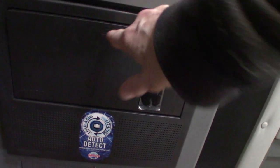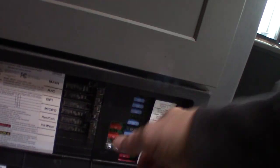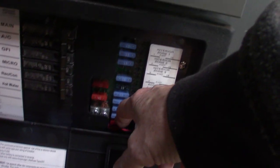This is your power converter — it converts AC to DC power. When you're plugged into shore power, you've got regular circuit breakers like you'd see at home: 110 AC, and they're labeled. The power is converted to 12-volt DC on this side — you've got 12-volt fuses and they're labeled. If they glow, you'll see them glow through this tinted plastic. Also, this is a battery tender, so it'll sense how much energy your battery up front needs and always keep it charged up as long as you're plugged into shore power.